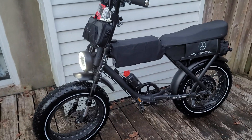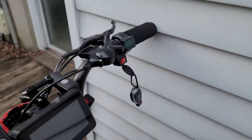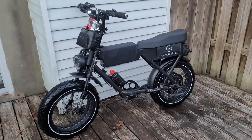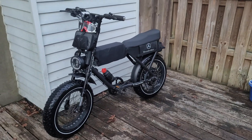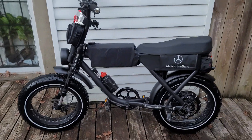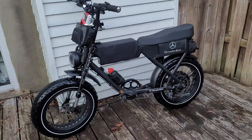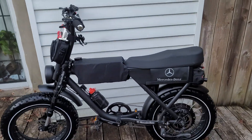It will probably run about 55 mph if I had the same setup on some 26 inch or 29 inch tires. But because of these 20 inch rims, it takes a whole lot more RPMs to get it up to 60. Right now I have my current limited at 50 amps, so with 50 amps I'm only getting around 3.5 kilowatts.